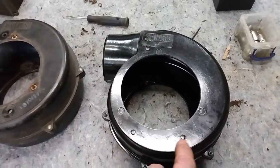The bolt will go in from the back side of the case, and then this little washer here has to go over top of that and into the little recess. What I'm going to use to push that washer on is a socket that's about the same size as the washer but will go over top of the bolt. That will allow me to push that washer on all the way and keep it reasonably straight. So there's the first one in place — you can see the washer all the way down in the little recess. If I flip this over, you can see the bolt head down there in a little recess on the other side. The idea is that when you go to put the motor back on, that bolt won't spin.